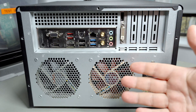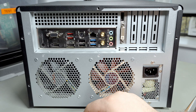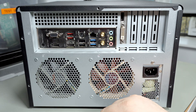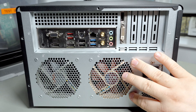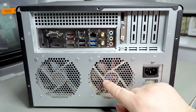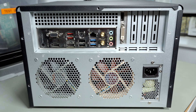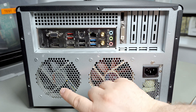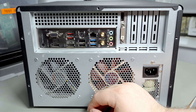The biggest difference between this and the UNAS version is that the UNAS version has different dimensions and is able to fit dual 120mm fans — that is a big difference. With Noctua fans in here, which are really good but are a trade-off between sound and airflow, this just cooks drives. There's no two ways about it.